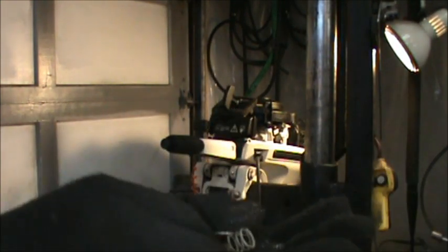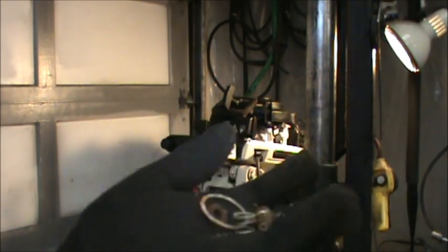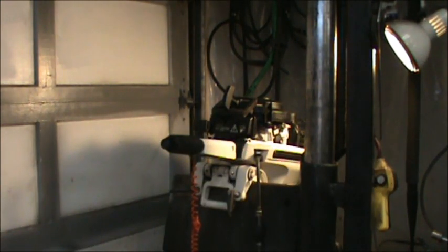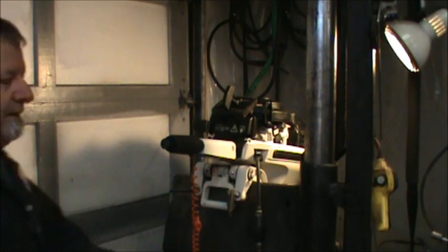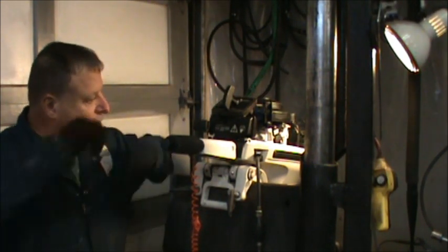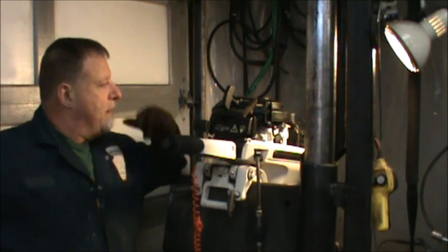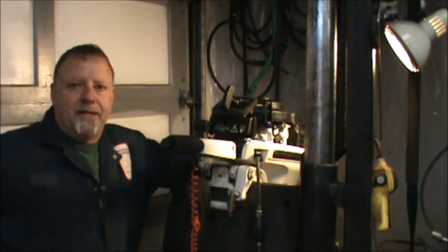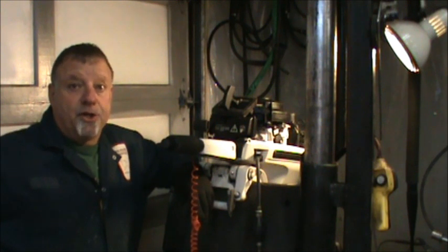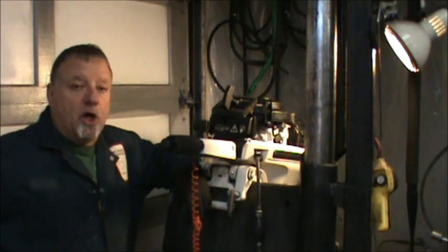So there's what's left of the thermostat. It's just a piece of junk, the poppet and all. I'll have to look and see if I got one. I don't think I do. But all that heat that I had going down here in the leg and everything is completely gone. That thing's nice and cool. It's just barely lukewarm. Without the thermostat in it, no matter where I checked on it, I couldn't get it hardly to 100 degrees. I found one spot at the top spark plug, right at the plug. It went to 102.